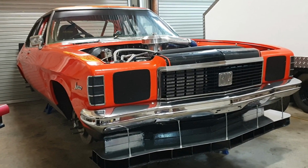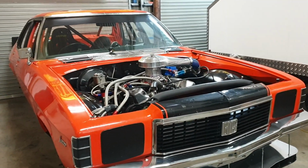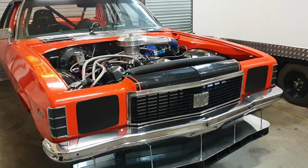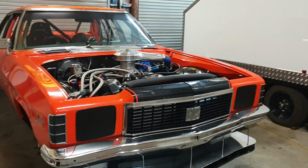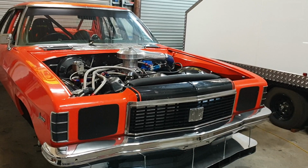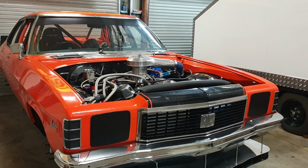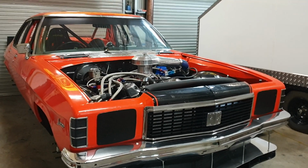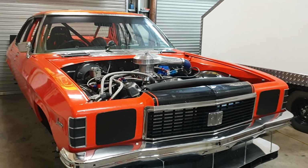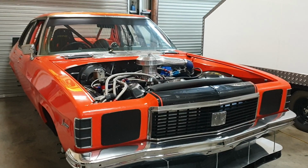And I'll give you a little tip, guys. Not a tip, but I'll let you know that I haven't re-torqued the heads when I did the gasket. So yes, we did go, I think it was 80 foot-pound, but it's not re-torqued. So that goes to show you guys that if your tune's right to a certain level, in boost I mean, they're not that hard on head gaskets.